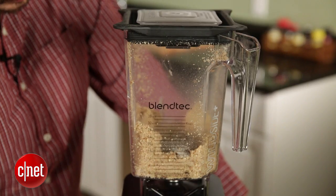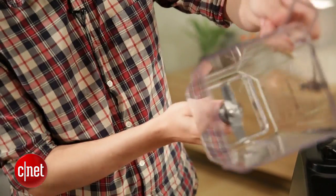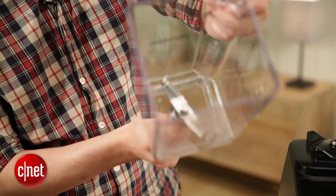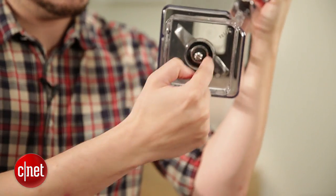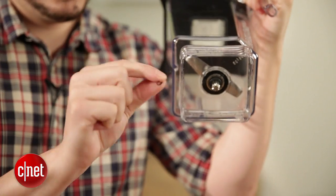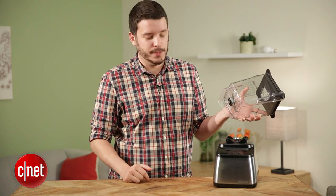This jar doesn't really sit on there totally secured — it's not locked in. There's nothing that's really bracing it. So as you're blending with all that power, it's going to move a little bit, and the rubber gasket at the bottom that seals around the spindle gets shredded. The result is you get all this black rubber coating the rim and little bits of rubber at the base. This gasket gets shredded and pretty soon it's leaking water and the blender is basically unusable.